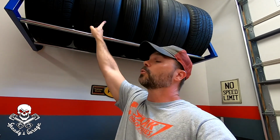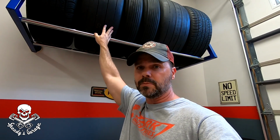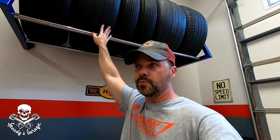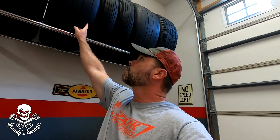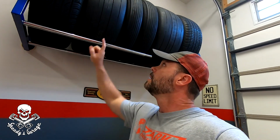So I called around and was able to find two 305s. So I've got Mickey Thompson ET Street R's in the 305/45/17, which is what I ran before. I'm hoping with those being new, they will help the traction issues I had the last time out. It was hit or miss, but the previous tires were worn all the way down, like you couldn't even hardly see any line on them, much less the wear mark. I was lucky to find the two.